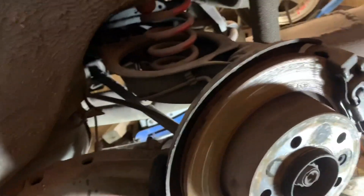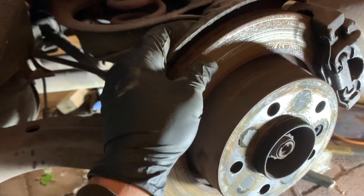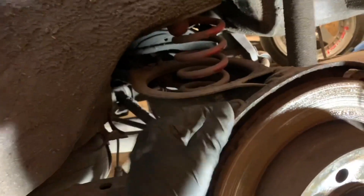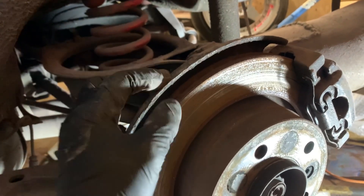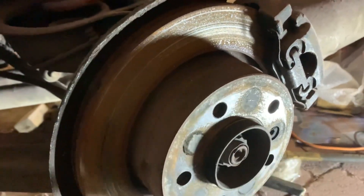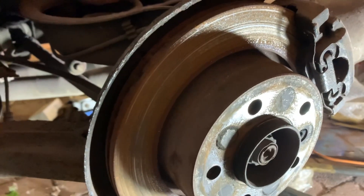I'm going to be taking all the arms out. I'll also be removing the brake dust shield while it's all off because I won't be running the drum brakes anymore - I'll be doing a dual caliper hydro, and my actual handbrake handle has locks on it so I'm just going to get rid of the cable brake. I don't want it - it's just another thing to fail in there, and another annoying thing to put back together, so just get rid of those.